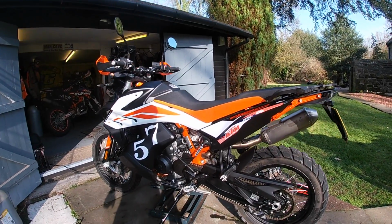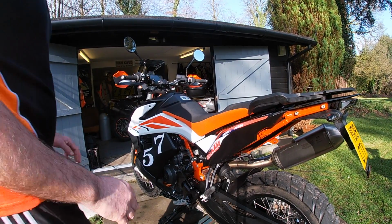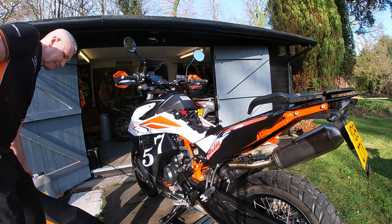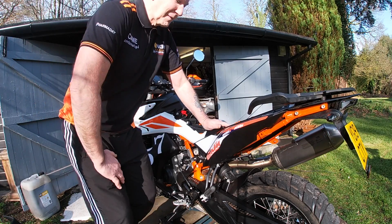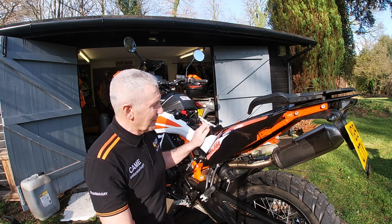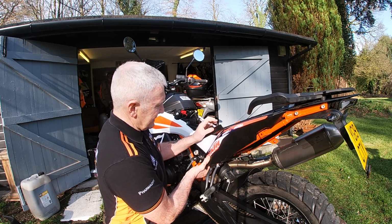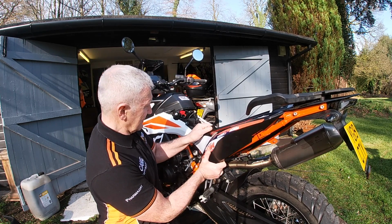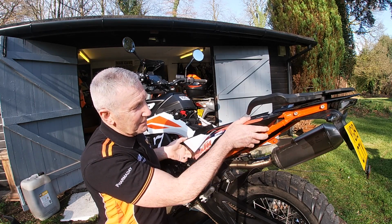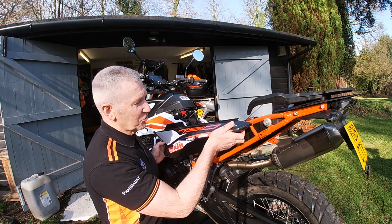So I've given it a good wash, and what I've done here now is take the saddle off and just slide it out. Now, obviously I've not read the manual properly, but the toolbox is kept in the side casing here, and when you first get a brand new bike you're reluctant to pull at things, but it's just like a motocross bike. You just pull the plastics at the side here. See, it's a bit stiff at first, but you're reluctant to pull a brand new bike and then slide it down the way. It's got a U-shaped dowel here, and it literally just slides off.